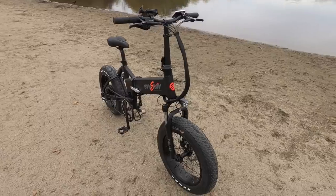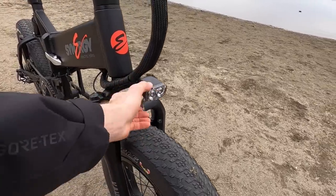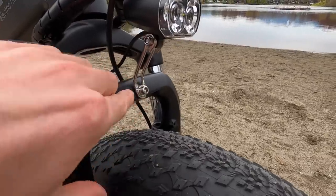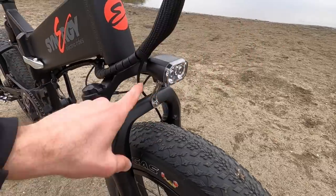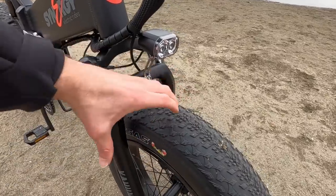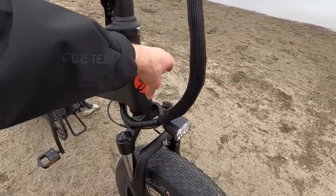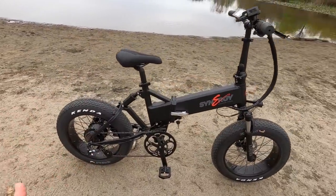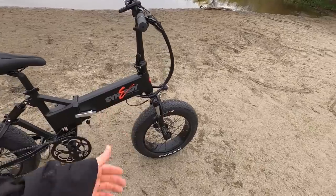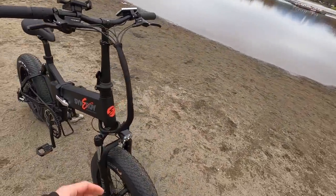I love that they've got an integrated headlight — it's a Blaze light with two beams, fairly bright, and somewhat aimable. The mounting arm is knurled so it won't pivot side to side easily. However, it's mounted on the bridge of the suspension fork, which is the unsprung portion — just like the rack. Ideally you'd have the light on the frame but still pointing where you steer, which it does now. On a black bike with no real reflective accents and sitting lower to the ground because of the fat tires, visibility is something to think about — though this is more of an off-road bike.